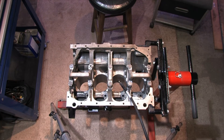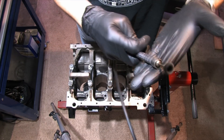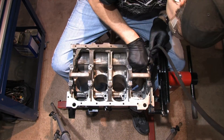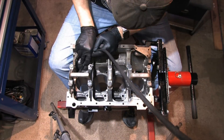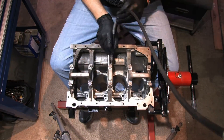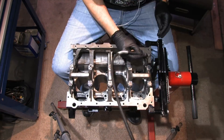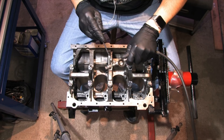It didn't take me long to figure out that I needed to use the squished cylinder head dowel pin on the end of the flex shaft to protect the block from the chuck of the flex cable — I forgot all about this thing and it helps to protect your precision machine work. It didn't take long to bring that shine right back out that was there before the post-machining washing, burn-off oven, powder coating, and baking. Parts that sit for long periods of time should be oiled, and I intentionally didn't oil this crankcase at all. I coated machine surfaces for the bores and mains with automatic transmission fluid and left it shrink-wrapped and double-bagged indoors on an engine stand. I didn't want to oil surfaces that I knew I would apply a coating to because I want that coating to stick.